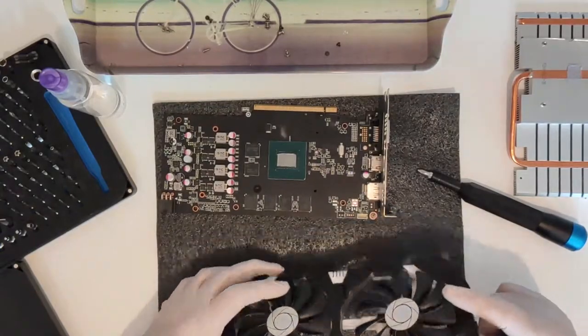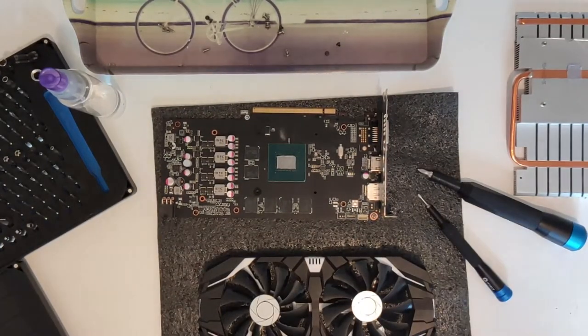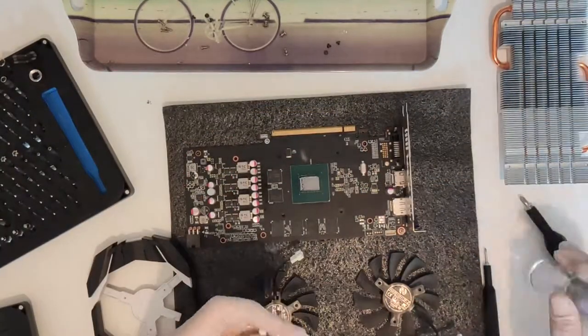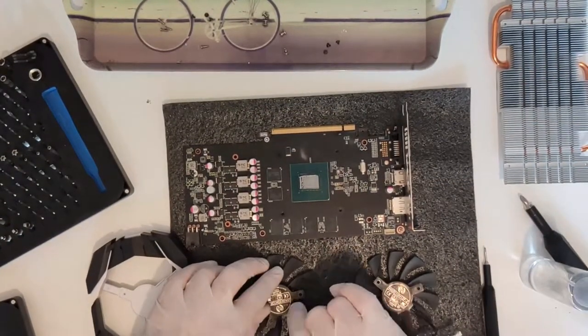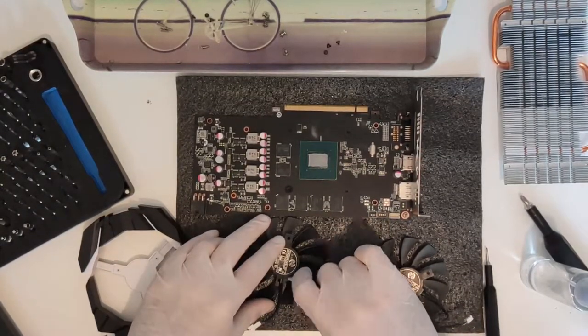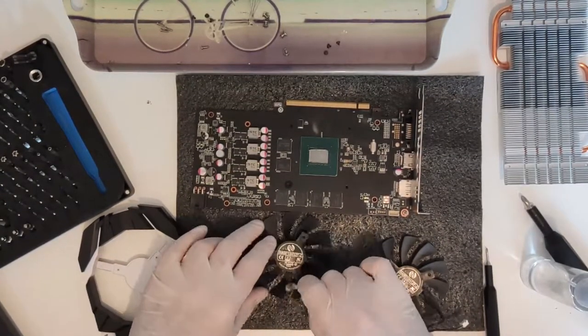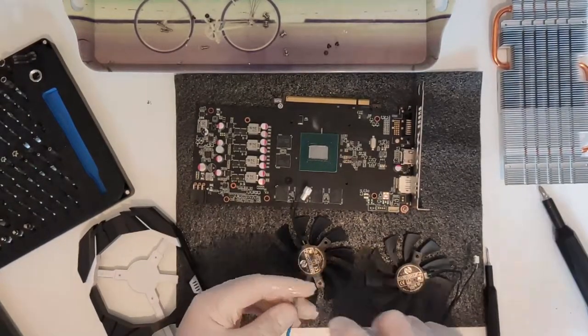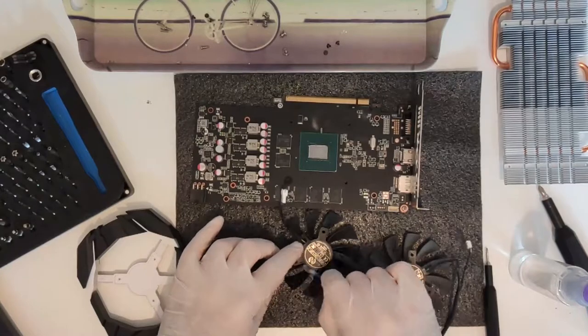On this GPU, MSI used a much simpler, cheaper extruded aluminium block and attached a heat pipe to it that runs on top of the GPU die to better dissipate the heat. While adequate for this 120W card, I would not want to see this type of construction on any card that draws more power than this — the surface area would simply not be enough to effectively dissipate any more heat.